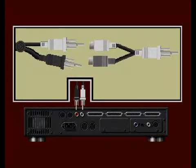If you wish to use the audio outputs on the CDTV player with a mono device, you will have to purchase a Y adapter cable from an electronics or video store. First, connect the stereo audio cable to the back of the CDTV player as shown. Then connect the two leads from the Y adapter cable to the left and right audio cables. Finally, connect the single lead from the Y adapter cable to your VCR or TV.